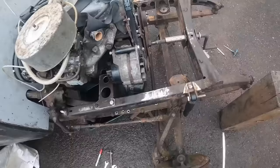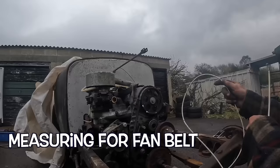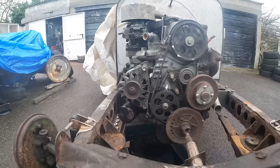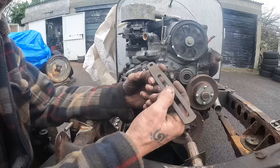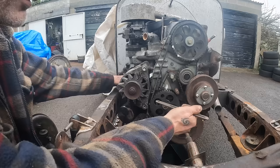Okay, so what I did was drill these out and I put 10mm into a thread there, and what I'll do is Loctite them when it comes to it. My smallest distance is going to be about there. That's it. Right, okay, so now I need to fit this bit so this will adjust. It's only going to have to move a little bit like that just to pinch up. You would look over here and think, where am I going to take it? But where I'm going to take it from is the chassis. This engine's solid mounted. Now you know why I do it.